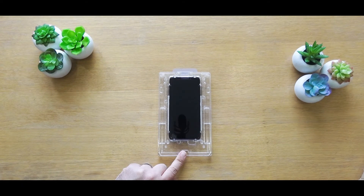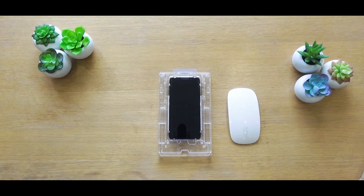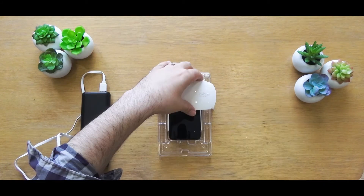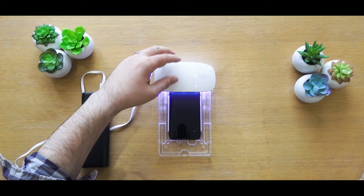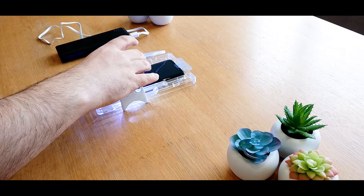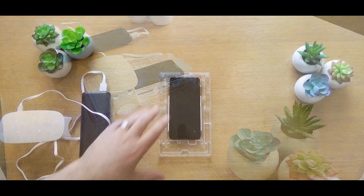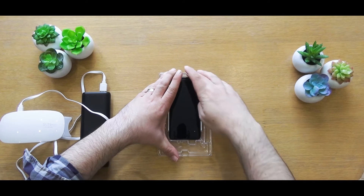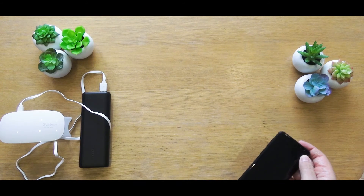You'll need to wait around 60 seconds for all of the glue to spread to each corner of the screen protector to ensure full adhesion to the screen. The next stage is to use the included UV lamp — which looks suspiciously like an Apple Magic Mouse — and ensure this is connected to a USB power point. Once you do this, set it on top of the screen doing 15 seconds at the top of the display, and then move it down to do another 15 seconds at the bottom of the display. Once this is complete, remove the phone from the tray and give it a good clean all over to ensure any glue which has escaped underneath the phone is fully removed.